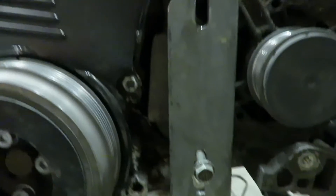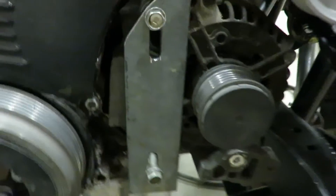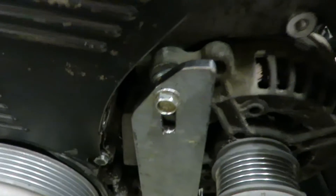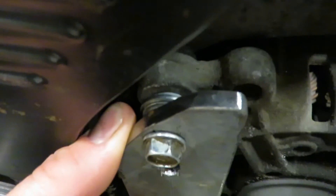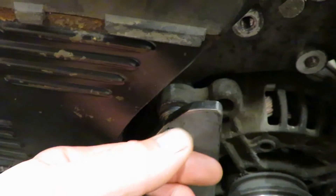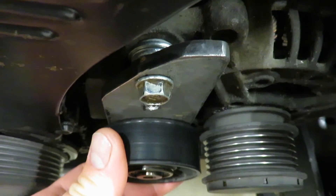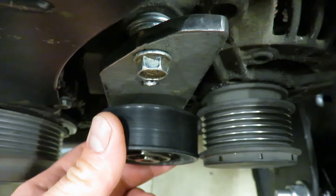So this is what I've got built so far — it's a quarter inch plate made of steel, and it's bolted through both bolts for the alternator. You've got to use a spacer on the back side of it — I just got washers there for now, but I'm gonna order up some spacers, it's got to be about three eighths of an inch. And then this is also gonna need a spacer about three sixteenths, I measured, to stick it out right in line with the pulleys.